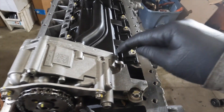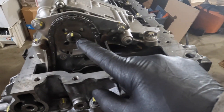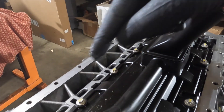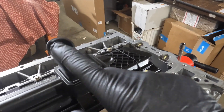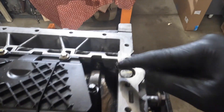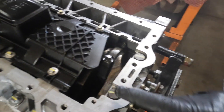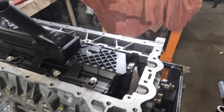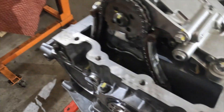Verify your oil pump is torqued — you've got your visual indication that it's been torqued. Your oil pump nut has been torqued, your baffle plate has been torqued. Inspect your suction tube, make sure there's no debris inside it. Inspect inside with a light — no debris or anything like that. Rotate the engine over, make sure nothing falls out.